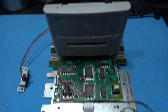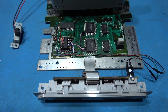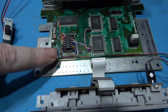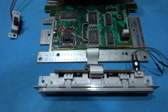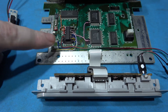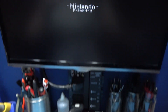As you can see, we're partially back together. I have Super Mario World in the cartridge slot. I want to give it a quick test - I'm going to know fairly quickly if this is a successful install or not. This chip now takes over the function of the lockout chip. If it's not wired in correctly, the lockout portion won't work and the system won't boot. If we get a successful install, this will take the place of the lockout chip and we should get a boot. Powering on - and we do, so we've got a successful install.